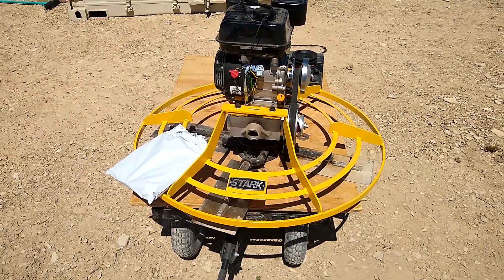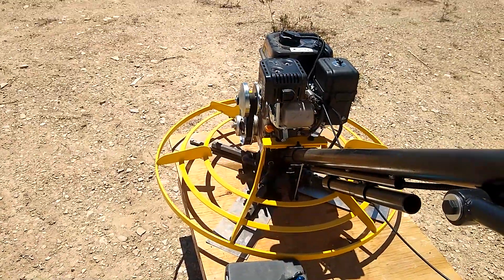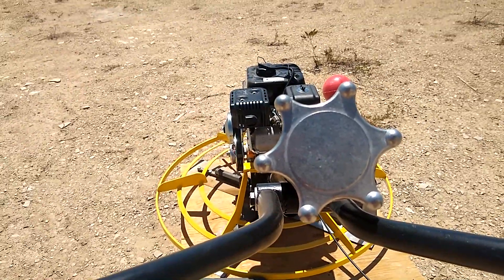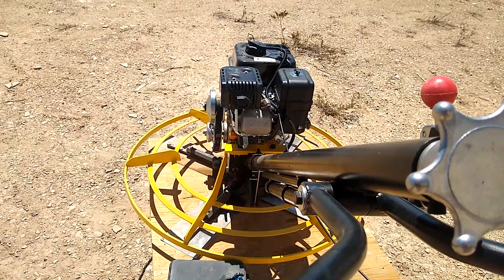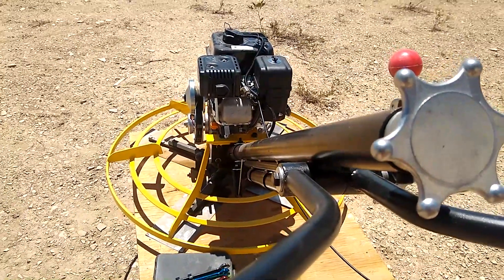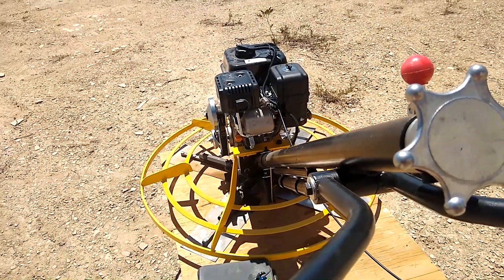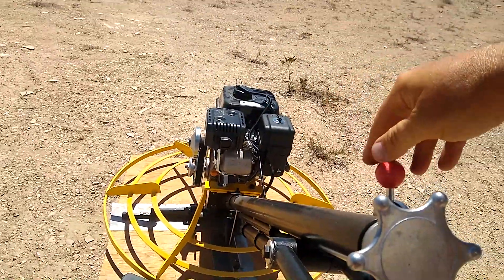It started right up. You can see the clutch is slipping like it's supposed to at low idle. There is still a tiny bit of drag but not much. You can see the print on that belt — I'm just trying to accelerate it slightly, trying to hold it with a finger. There it goes, it's just engaging now. Oh yeah, there it goes! I kicked that out before I hurt myself but it seems to be working.